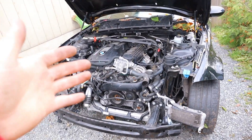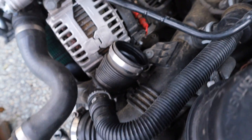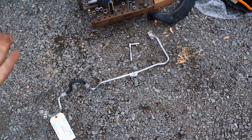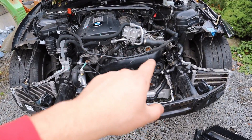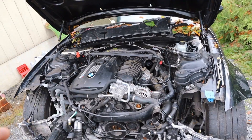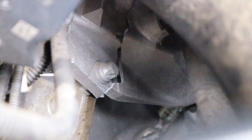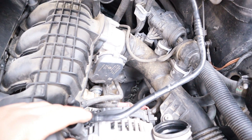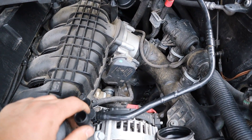I've pulled off the intake airbox because the AC line bolts up right there and it was in the way. Here's the old one - it's literally pancake smushed. I got a brand new one but unfortunately this inlet was the wrong one and didn't fit. It looks like it's the rear inlet or something. I got the correct one on order already - that's not going to stop us from starting the car. I did notice one thing though, and it's not a good sign: that is a busted motor mount. I don't know what that means but I'm hoping for the best. Got to get that part ordered.